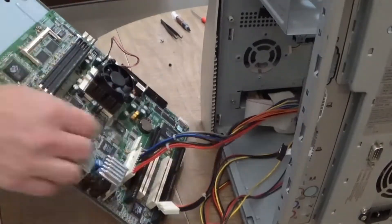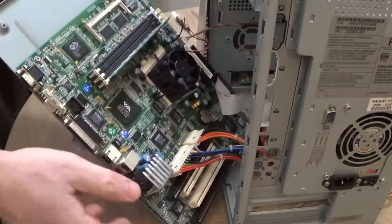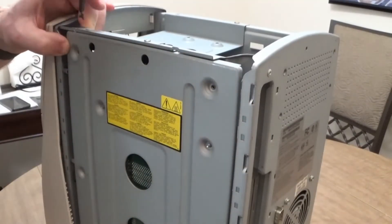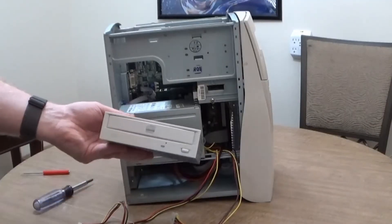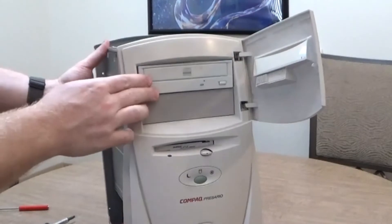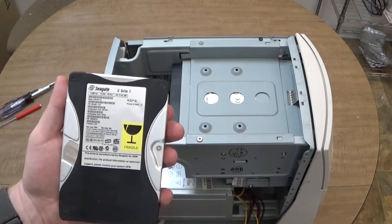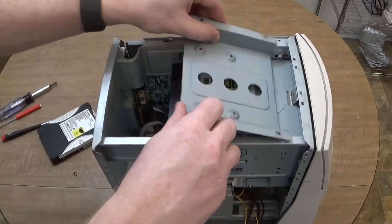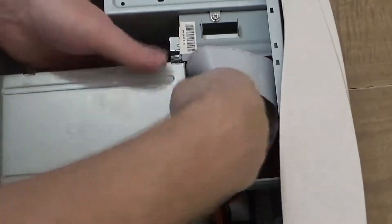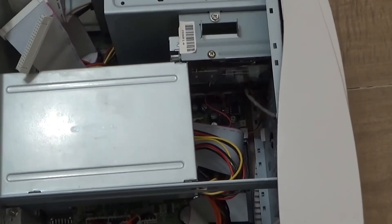There's nothing more we need to install on the motherboard for now, so it's time to put it back in the PC case and start connecting all the cables. Here we install the optical drive — a CD-RW drive from 2001. It's newer than the time frame this PC came out, but I didn't have an older working drive I could use. In the top is the hard drive tray, and I'll be installing a Seagate 10GB IDE drive running at 5400 RPM. Since I love making more work for myself, I decided to not plug in the IDE cables to the motherboard before securing it in the case. Cable routing ended up being a pain, and I removed the power supply in order to get everything where I wanted.